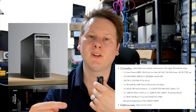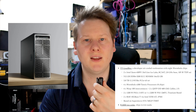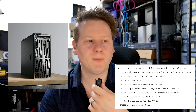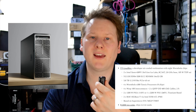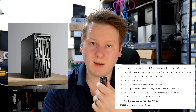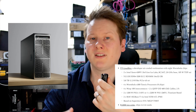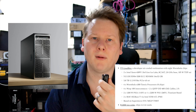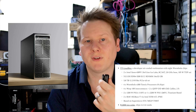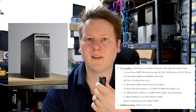The system has four Wormhole cards, air-cooled, with eight chips total, connected by four Warp 100 interconnect cables enabling a 2x4 mesh between cards. It also has two QSFP-DD cables — 400-gigabit Ethernet — for scaling out across multiple systems, plus two 10-gigabit Ethernet ports powered by an Intel 550 NIC, IPMI, and a power supply sized for either 110V or 240V regions.